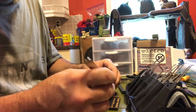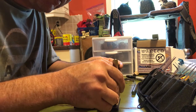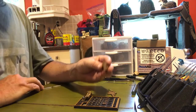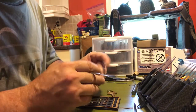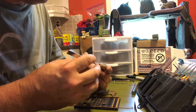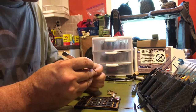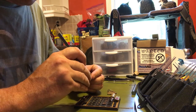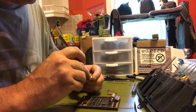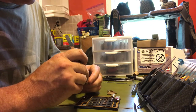These little guys are not bouncing up like I thought they would be - they're caught a little bit. I'm making a mess of this gutting, guys, I'm sorry. So we do have some work upstairs. We've got threading on two, four, and five. Let's see - we've got on six: smooth. Four is smooth. Three is smooth. Two looks - yeah, we've got a little bit of threading cut into two even. And one is smooth.